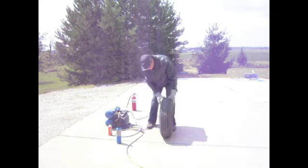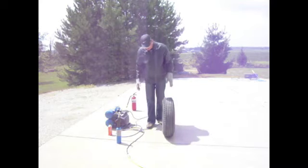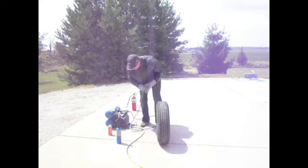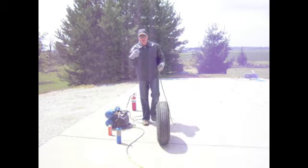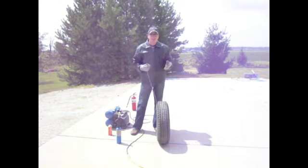Put the valve at the top. I spray fluid up into the crevice there between the tire and the rim. Now use a heavy rubber hose — those light yellow spiral ones are very thin and those can easily burn a hole in them, so I don't like to use those.